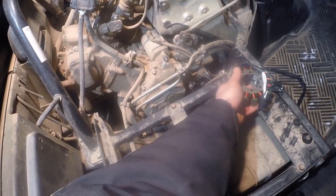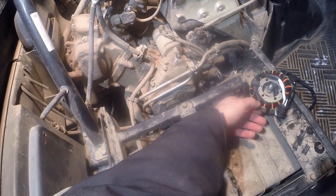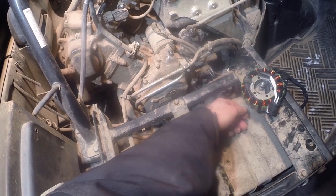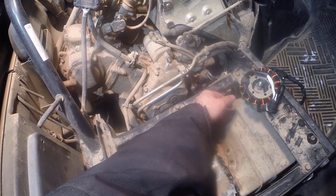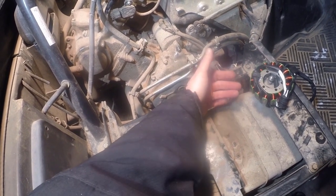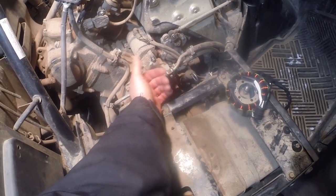The symptom was it starts fine, runs fine, and everything's great, and then over time it just doesn't want to start anymore. The battery just doesn't have as much life. I've already tested the voltage at the battery - the voltage was low and it just discharged as the vehicle was run, and that's a classic symptom of a voltage regulator rectifier going bad, or a stator.